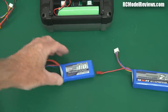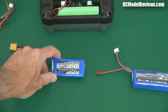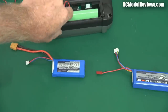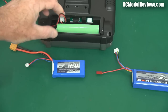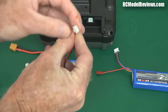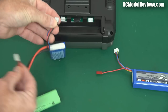Of course there's also the two cell LiPo option — this is just one I had laying around, not the one I would use. There's a two cell LiPo option which is 8.4 volts when fully charged, so it's around about the same voltage as the standard NiMH pack. Also the benefit of a two cell pack is the connector on the standard battery and where you plug your battery into on the Tyrannus — it's like a balanced connector.